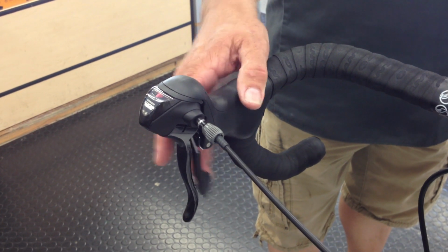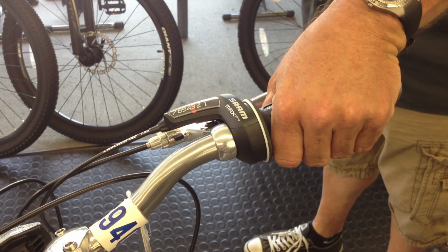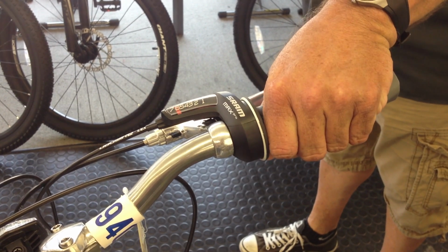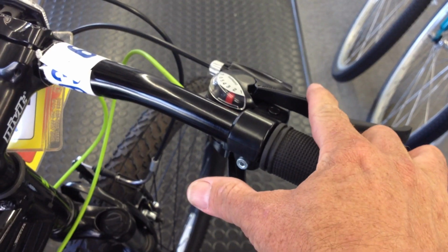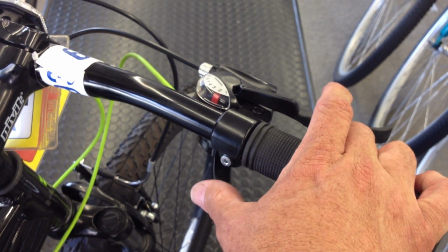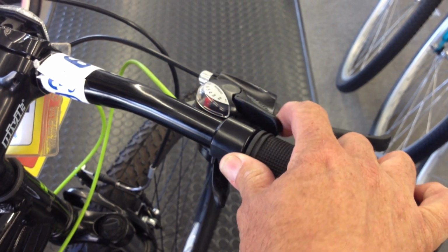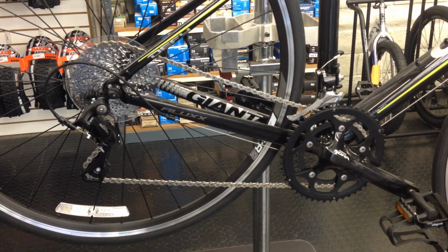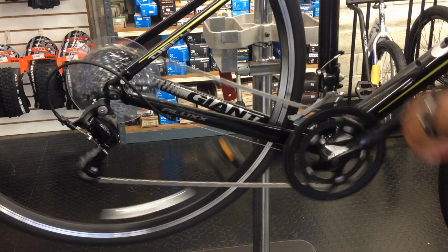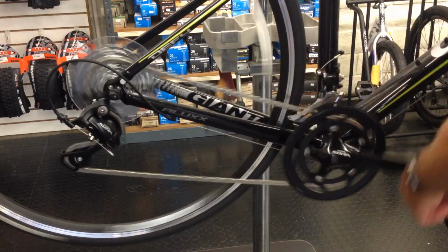Road bike shifters are built into the brake levers and have two functions. Hybrids and mountain bikes sometimes will use grip shift, or sometimes are equipped with rapid fire trigger shifters. The thumb makes it easier, your index finger makes it harder. We're using a modern road bike with a compact crankset as an example. A compact crankset affords a road rider a wide gear range without having to have an inside triple chain ring.